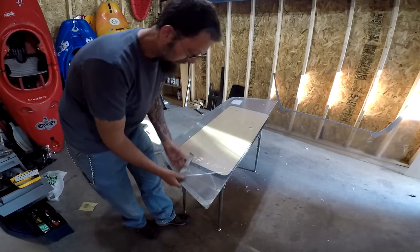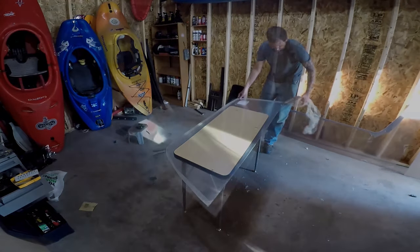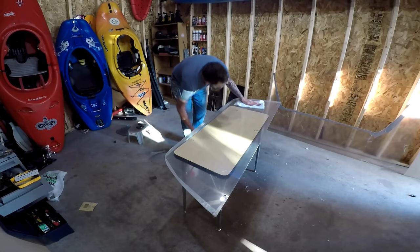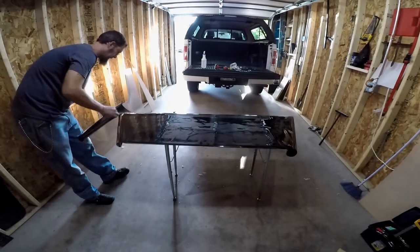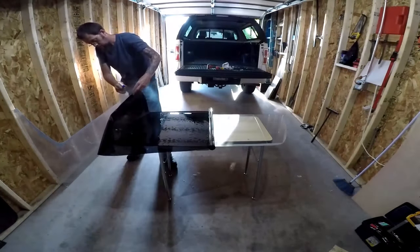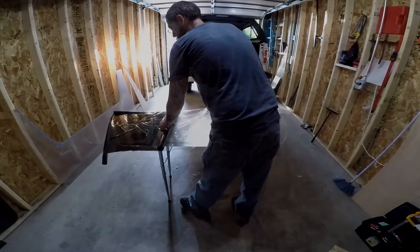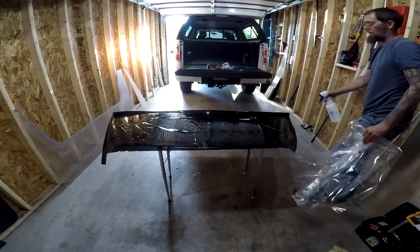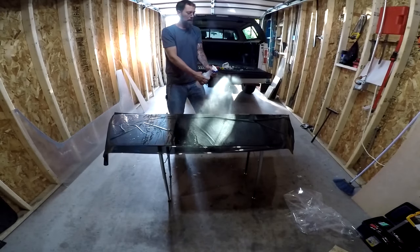With the holes lined up and drilled out, I'm going to remove the protective sheet from the inside portion of the window and add a layer of tint. To tint the window I'm just using a 5% tint I purchased at Walmart. I'm going to start by cutting the film so it's a little larger than the window. I'll then spray a layer of water over the window and pull off the inside sheeting to expose the glue side. I'll continue to spray the film with water to keep the tint from sticking together and activate the glue. Once the inside film is removed I want to spray a layer of water over the top so the squeegee can easily slide over the surface to push out the air bubbles and excess water.